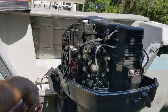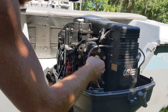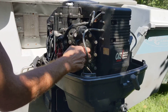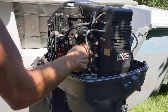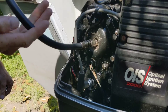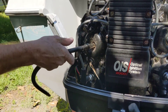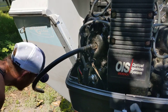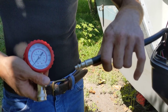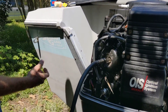I'll start with finding the right fitting — that's right there. Screw that all the way down, then screw this into it. Make sure we're getting some good compression on all cylinders. Plug this into the end — this is your gauge. It's plugged up on that. This is your little relief valve to let a little pressure out. Now it's gonna go up here and turn the key over.